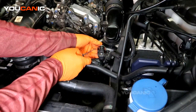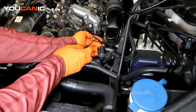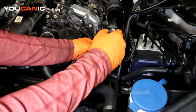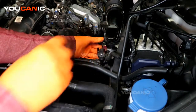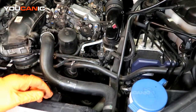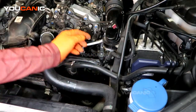We check to make sure that our electrical connector is good. We also check that there's no fraying on what we can see. If we've done those checks as best we can, we'll go ahead and start by replacing the sensor to rule that out, as well as doing visual checks to see if we have an EVAP leak anywhere.